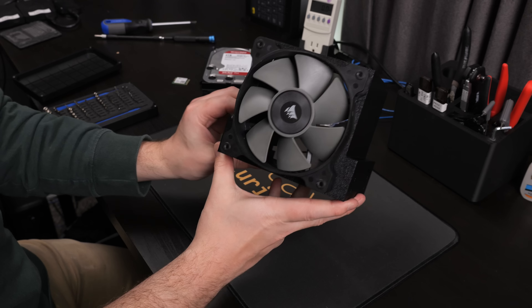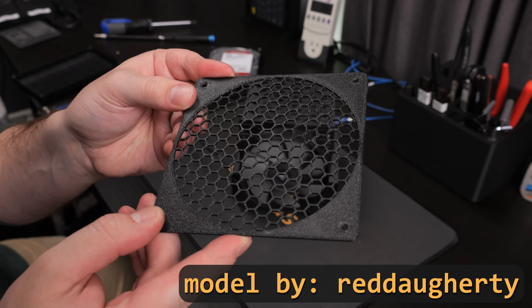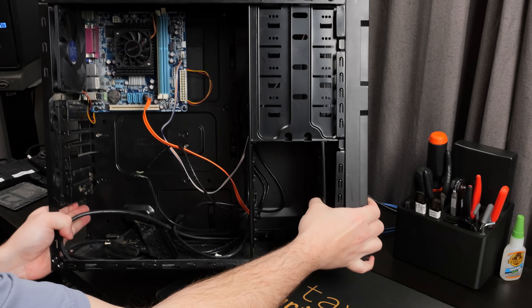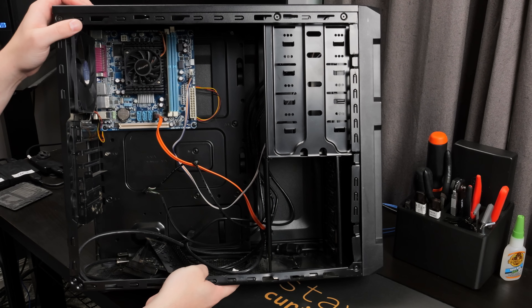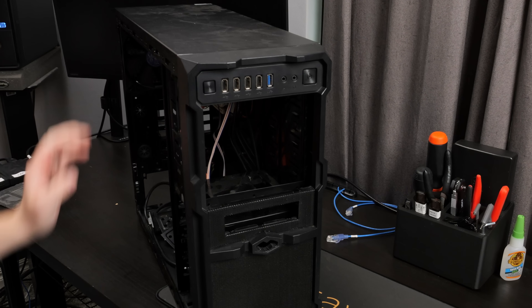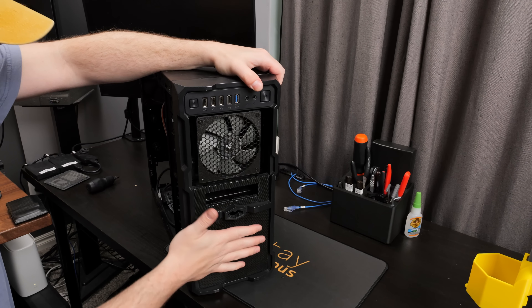The cage design also has room for a 120mm fan, but since that's not super pet or kid friendly, I also printed off a really simple fan grill and got everything assembled. I needed a case with three 5.25-inch bays to put this in, and I ended up grabbing a case that only some of the most OG viewers might recognize — the case I used back when I set up my crappy little $5 power supply server. For a cheap case I found in the trash, it's actually pretty cool with five 3.5-inch drive bays and those three 5.25-inch bays. I slid the cage in and screwed it in with no issues, and yeah, it's a little bit janky, but it's honestly kind of my style.